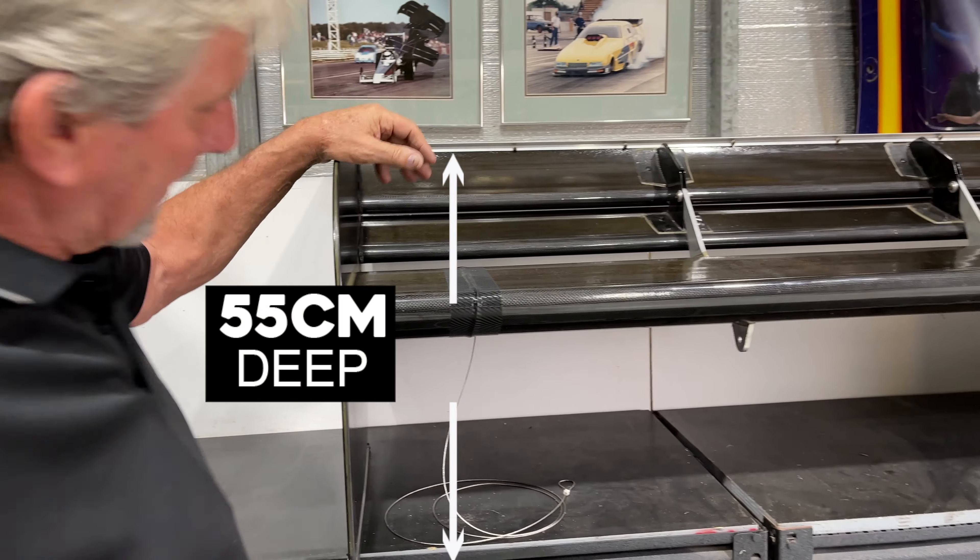These are the later versions. The earlier versions, as you can see here on one of my alcohol cars, used to be a two-piece wing. The cars used to move around a little bit, especially when you've got bigger wings on the back, so you need something on the front to keep the front tires planted so you have more steering. Apart from that, it's just pretty functional — you're trying to reduce the drag but still produce downforce.